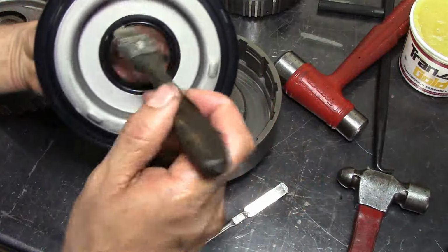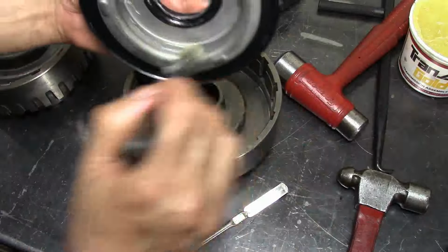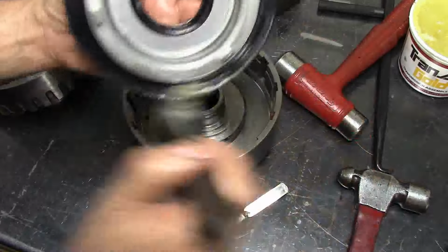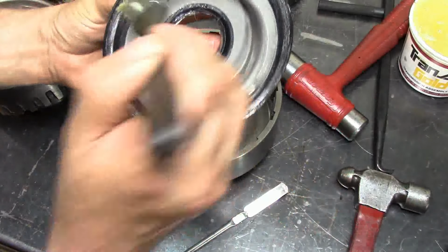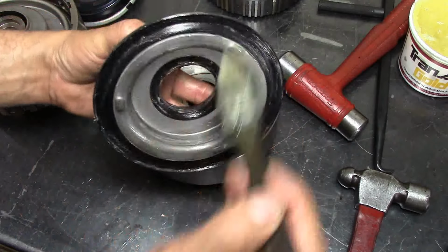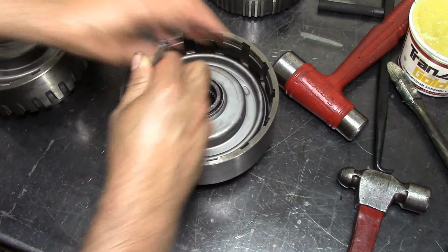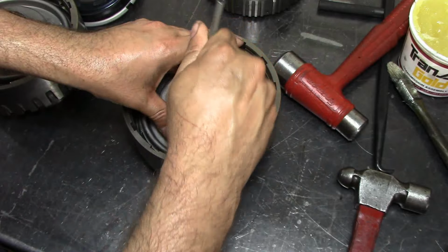All right, let's go ahead and lubricate our new pistons. You want to lubricate the inside where the lip seal rides. Now we lubricate the outer side of the piston. We're lubricating the lip. Alright, just put enough of it. Put a lot of it if you want to. Just make sure that you don't tear any lips. Attaboy. Now we get our lip seal installer tool, and kind of work it a little bit.